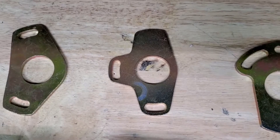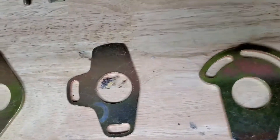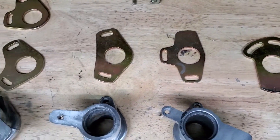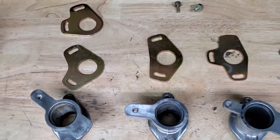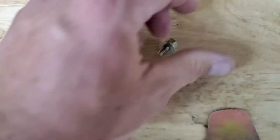I've seen a million distributors that are notched in this area here, just to accommodate for that wrong base versus wrong plate. So anyway, don't mess this up. I encourage you to use the correct hardware as well.